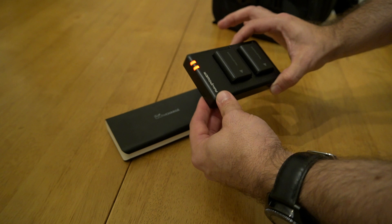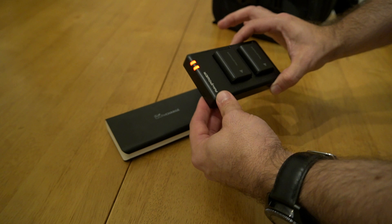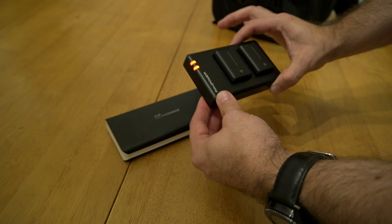All you have to do is pop one battery out, pop the next battery in, put it back in your camera, and keep cycling through as you go through your day. One key thing about the Sony a6500 you want to keep in mind is it does overheat after about 45 minutes to an hour of 4K filming at maybe 75 to 80 degree temperature, so you got to keep a watch out for that.